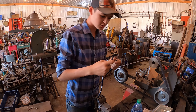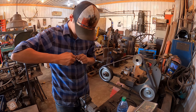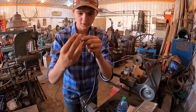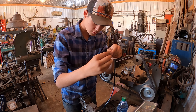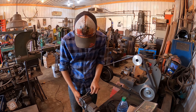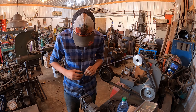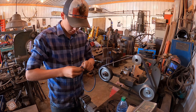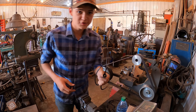This is going to be my new wire right here. So now I'm just going to make it so there's a little bit of copper wire sticking out. We're going to take this little copper or metal piece and then take this little piece of wire and stick it through, right there just like that. And then we're just going to squish this - I'll use the vise right here, handy. There we go, make sure that's nice and tight on there. And then we're going to put this rubber protector on here - it just keeps moisture from getting in and then shorting the spark plugs out.